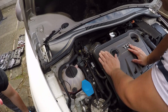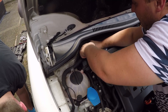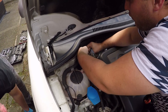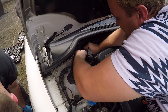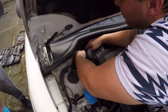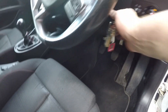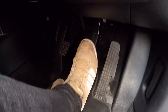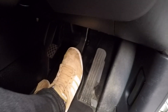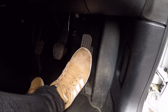So now we're just tightening the wheel nuts up on the wheel. We're going to come and tighten this reservoir back up — it has a key, just line the key up. We've actually done all four wheels now. We're going to get into the cabin, start the engine, and pump the brake pedal before we do anything else. Check that it feels right. The brake pedal is very soft at first and that firms up — the pressure's built back up again. Now it's working — let's give it a little test drive. Be very careful when you first pull away just to ensure that the brakes are working correctly.